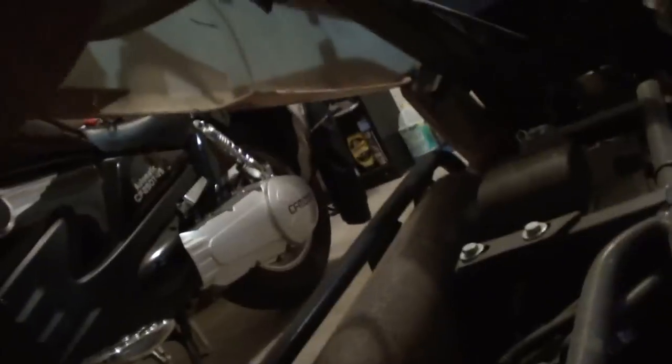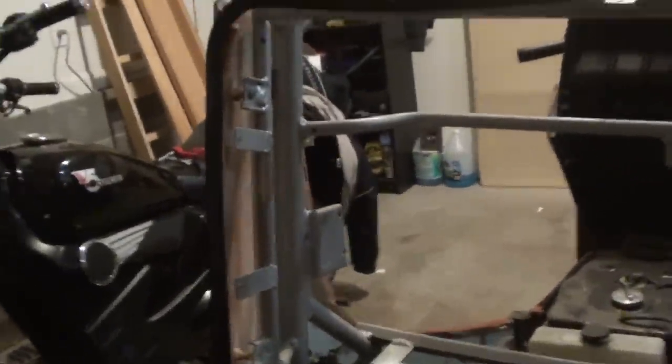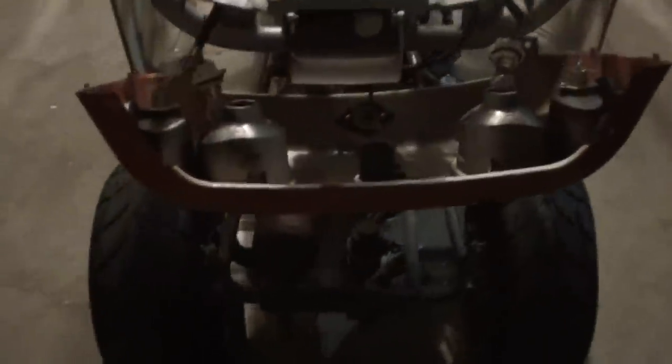The next step will be to remove the tail light assembly. That should just involve two screws on the top and two underneath — I could be wrong, but I believe that's all. Then from there we'll go to remove the side sections, which actually doesn't look to be held on by that much. It was just those four screws holding it in place. At this point you have the option of just removing the tail lights from the assembly and removing the panel, or removing the whole tail light assemblies. That's what I'm doing because we're going to paint it, so they have to be removed anyway.